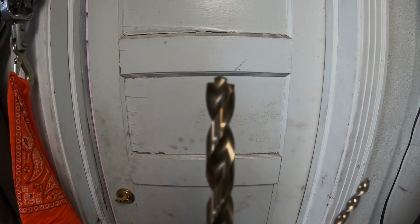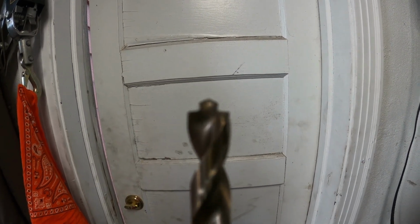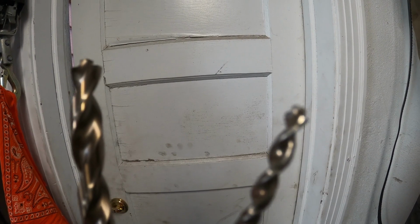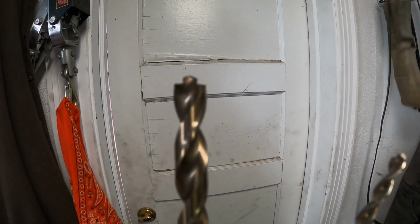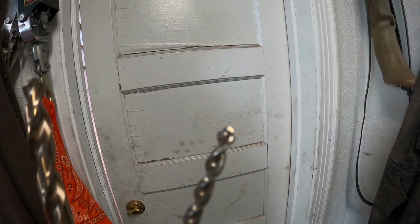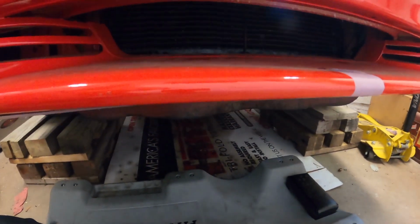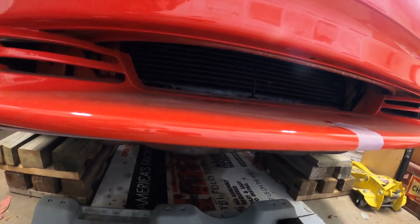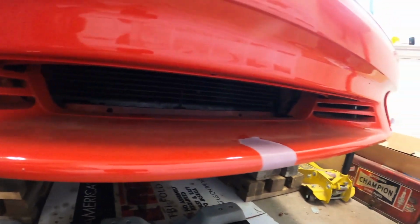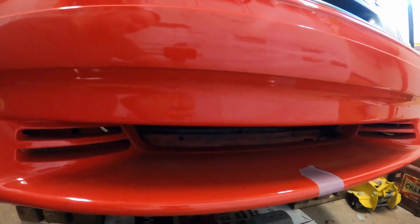All right, the 5/32 drill bit over here is the same size as this little starting tip on there. So I'd recommend, if this is what you are going to look for, this is a DeWalt bit. They both are. You see this one actually has that little starting tip as well. Instead of trying to do a unibit, because as you can clearly see here, if you were to use a unibit, you are going to go through the top of this air scoop as well, which I don't recommend you finding that out the hard way. Again, that's a DeWalt. I forgot what it's called. I'll link that in the description.